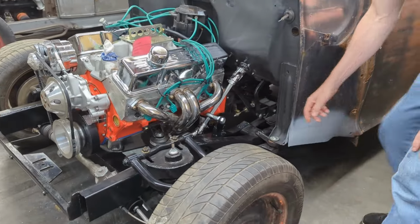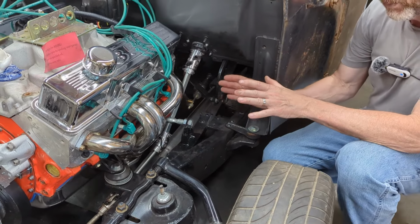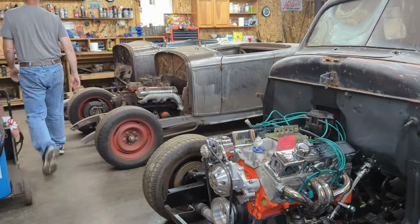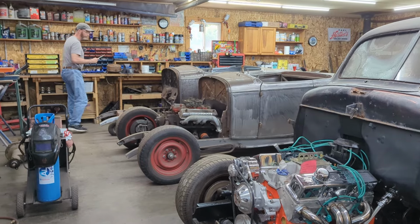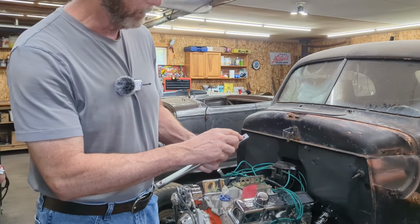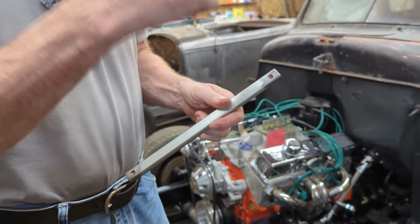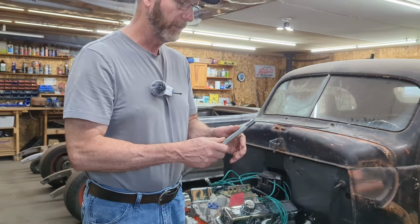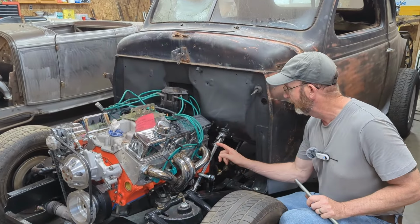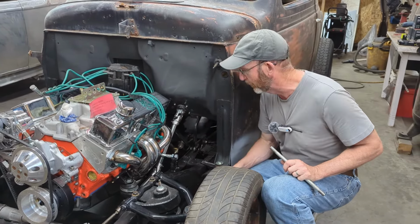Then on a previous episode, I talked about putting the extra steering knuckle in here and getting clearances. What I found is once I put everything in place, there's one thing I'd like to show you with my steering shafts. Once I cut the steering shafts, you put the set screws in and make little marks. I like to go over to the drill press and put a 1/4 inch hole there, so that when a set screw goes in, it actually goes in the hole and makes a physical connection, so nothing will come loose. On top of that, I'll Loctite these. Maybe later on somebody's going to curse me for having to undo it, but they're not going to come undone, is the point.